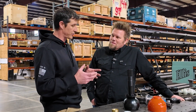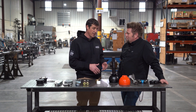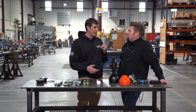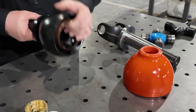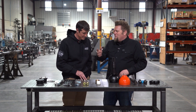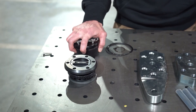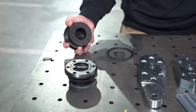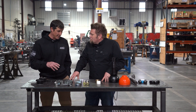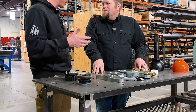With this one, it's got a long shaft, so we have some torsional twist in there, which adds a little additional strength. And now we have an option at the wheel end. We've got two options: a slide-in 40-spline slug — basically direct drive — but if there's an issue, you just pop the cap off, four bolts on the trail, pull that slug out, and now your wheels free-wheel. We also have the lockout.